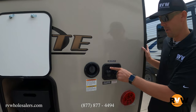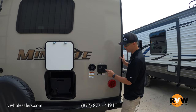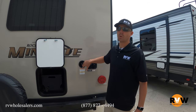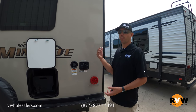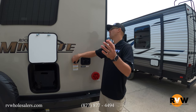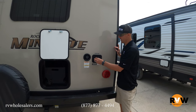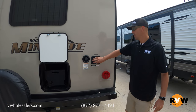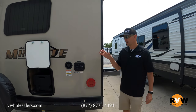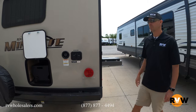Over here you have a couple of different connections. Cable and satellite hookup is right here if the site has hookup available. This is going to be your city water connection, fresh water fill, and this is going to be your antifreeze inlet. If you're going to camp without water hookup at the site, you'll fill your fresh water tank — the onboard tank — and then use your 12-volt pump to pull water out of the tank to pressurize the taps, toilet, and shower. If there's no filling station at the campground at all, you can fill it up at home and take it with you. The city water connection is for when they have water hookup right at your site — hook your water hose into this and use a water pressure regulator to reduce the PSI. The antifreeze inlet lets you put a short piece of hose in a jug of antifreeze, turn the pump on, and pump antifreeze through the lines.